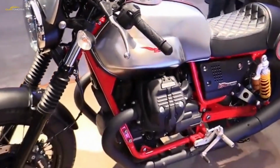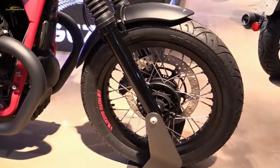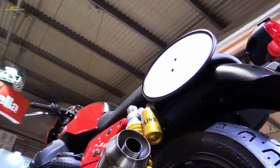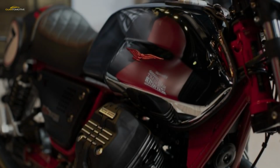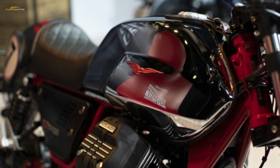The factory rebuilt the V7's transverse-mount, 90-degree V-twin with an eye toward efficiency, as evidenced by the measures it took within the revised aluminum case. Improvement in the ventilation reduced the pumping losses associated with the air's resistance to getting shoved back and forth through the engine due to the reciprocating motion of the pistons.